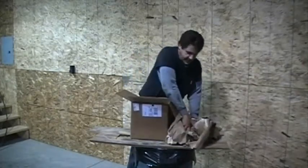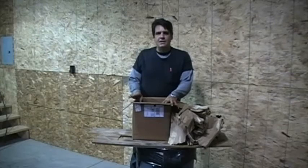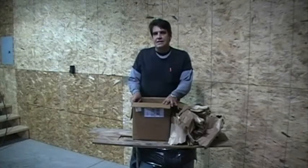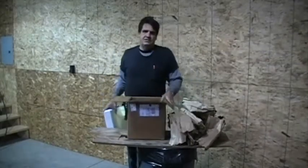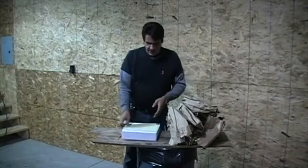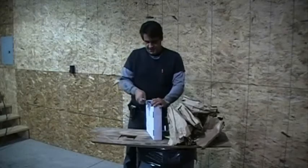Just to bring you up to speed, this is a 2001 Ford Explorer with a 4-liter single overhead cam V6. One of the nasty problems inherent in the design of this engine is that the timing chain guides are all plastic and they have a tendency to break, and when they break, they allow the timing chain to go slack, and in some cases slack enough, in this case anyway, to make the engine jump time. And unfortunately, being an interference engine, it wreaks a lot of havoc in there. And of course, in the previous video you saw the 3 dents in the pistons and all that.